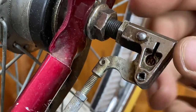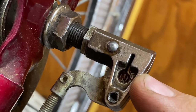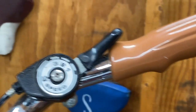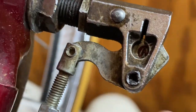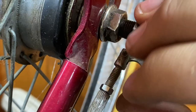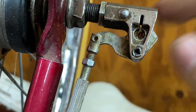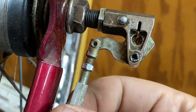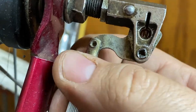So this is your actual shifter. If you take this apart, there's a rod inside this — it's almost like a quick release. It's hollow, a hollow shaft inside, and then this is what changes gears. If you notice there, the end is in that, and I am in first gear. The correct way to change it is to first put this into second gear, then come back to your shifter. You see the end is off — this is where you adjust. First, loosen the tension nut back to get some space. Then you twist this, tightening it, and watch the end. You want the end smack dab in the middle — about like that. Then tighten your tension back up. That keeps it from moving.